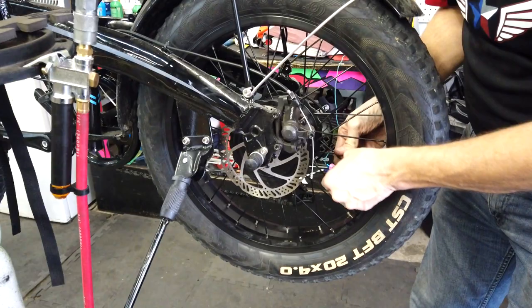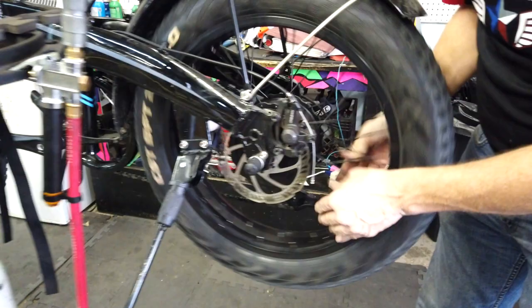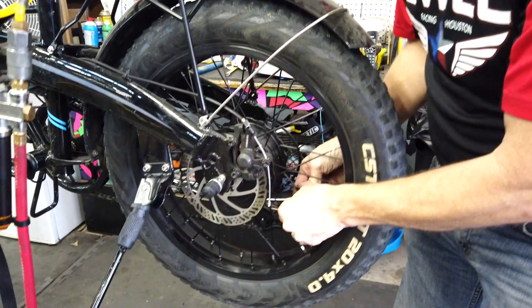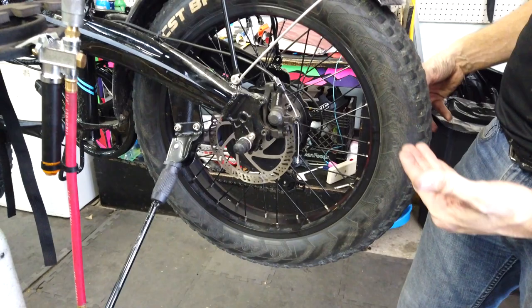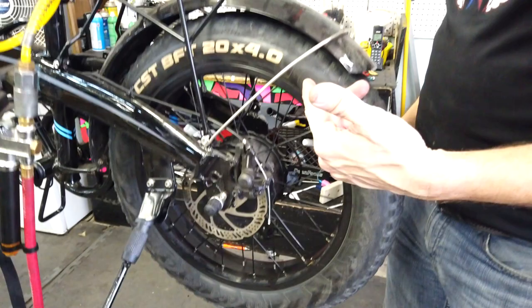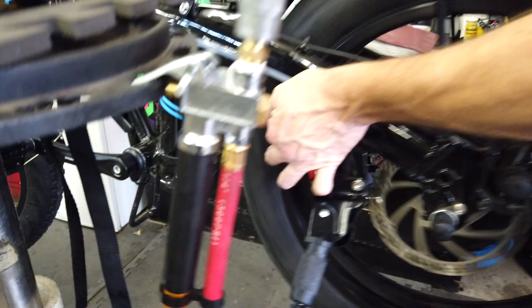That's why I put the caveat in there like — alright, the next thing is it's an electric bike. Because I know some places won't. And truing it versus just tensioning it, which is what I just did — in a way tensioning is a little easier than truing. Because truing it, I don't have a tool — I don't have anything that guides me to make it straight. I actually have to make something or put my finger there. With bikes with regular brakes we can use the brake or put it on the truing stand — that blue U-shaped thing. But your wheel probably doesn't fit in it.